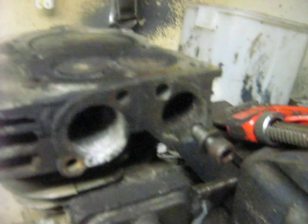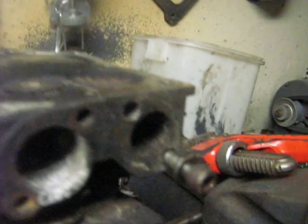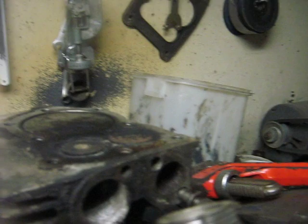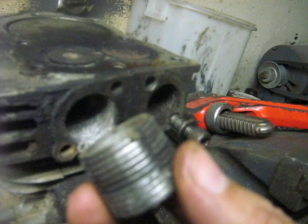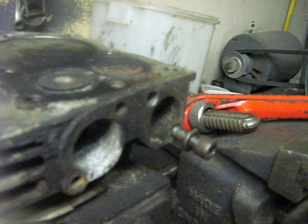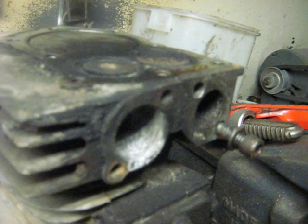Be as gentle with it as you can since it's not made of tool steel like a regular tap is, plus you're just dealing with aluminum threads too. Anyway, that's just my suggestion — a homemade three quarter inch pipe tap in effect, to help you clean out the exhaust threads on these Briggs and Strattons with the three quarter inch pipe in the exhaust. I'll see you next time. Bye!